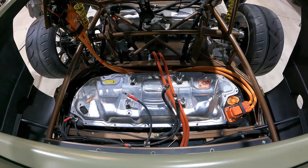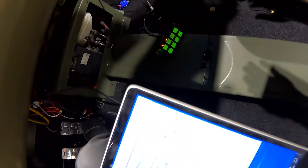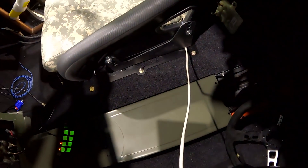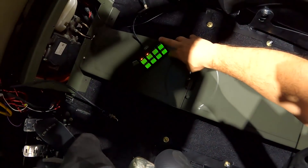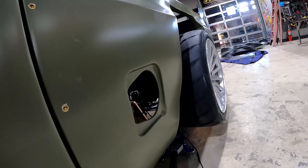Focusing back on the wiring — we ran into some issues. We were able to send the messages and data needed to the battery pack to bring it online, but it was sending back fault codes. We had to go inside the penthouse and make some changes to the battery pack. Basically what we did is terminate the high voltage interlock loop. That's a safety feature in the battery pack to prevent the contactors from closing if there's any kind of short in the high voltage wiring. It is a safety precaution — don't try this at home. Hopefully we'll get these wheels spinning. This is our main ignition — you can start seeing data streaming from the battery pack. We're putting it in rear wheel drive mode to try to get the rear wheels to move, start the inverter, send the message to the contactor — we should be able to hear it close — and then we'll turn the motor on and put it in drive.